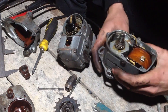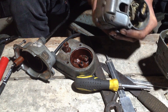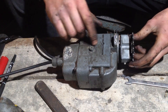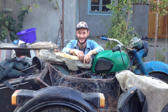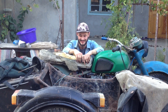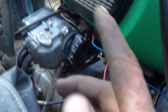I wasn't able to swap parts between these two magnetos — their internals are completely different. So for this magneto to work normally, it needs to be installed on a crankshaft. Or we can install this magneto — it's simpler than this one and it gives two sparks per revolution, exactly what we need. But it's clockwise rotation. So either make a new mount for the right-hand magneto, or make this magneto rotate twice as fast. Now we have a 16-tooth sprocket here. If I install an 8-tooth sprocket here, it'll rotate twice as fast. I suppose this should save us. From my satisfied face, you should have already understood that everything worked out and I finally started this nipper with a magneto. I made this mount real quick — it's over there under the tank. Since this is a clockwise magneto, I can't put it here now, it has to be there. So I installed it, simply connected the plug wires, randomly set the ignition, and it started first kick.